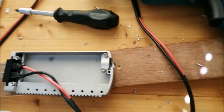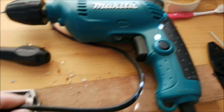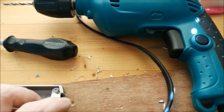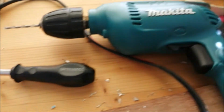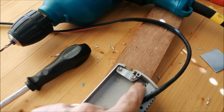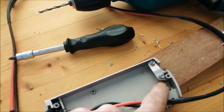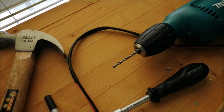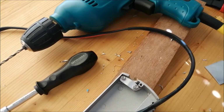So I go ahead, I will cut the rubber from a tube from a tire and weld it around the cable so that it seals against the housing. And I will drill the water release hole at the deepest point, which will be around here, and I believe I take a 3.5 mm drill for that, and yeah, I guess this will be next.